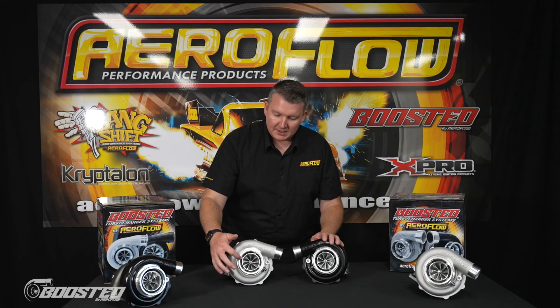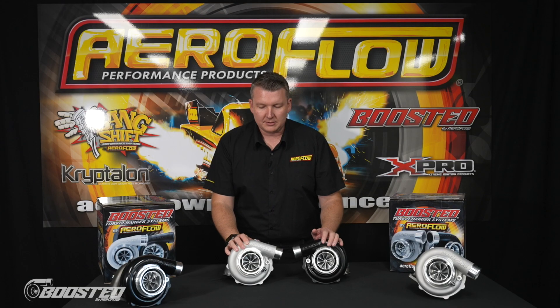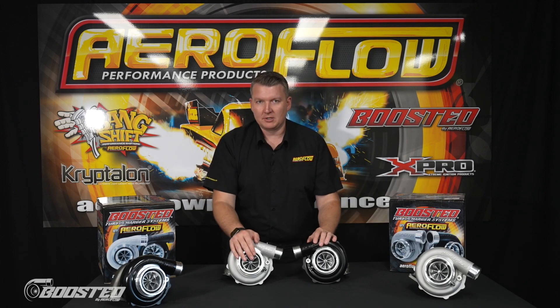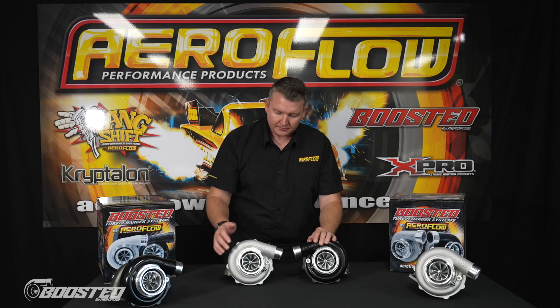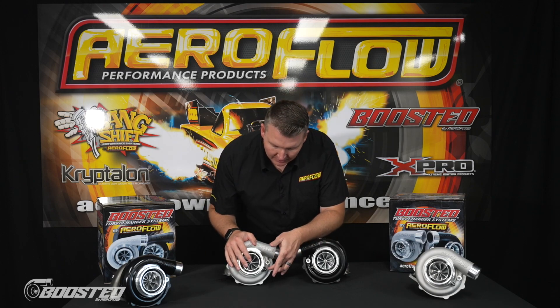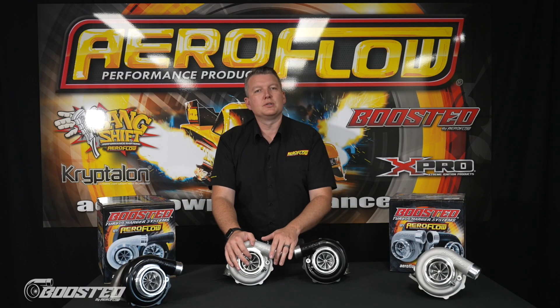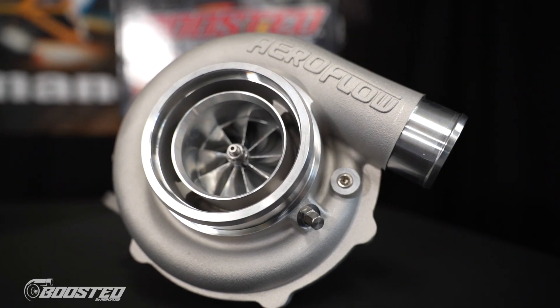You might also notice there are nine blades on this compressor wheel, which is a new development in this generation of turbocharger. The nine blades on both the compressor and the turbine means these turbochargers are really well balanced, so the inertia required to spin both is actually much lower — making for a more responsive turbocharger. The housing features not only a speed sensor port, but also a 1/8 NPT auxiliary port, which you can use for a boost reference or any other sensor requiring a boost reference.